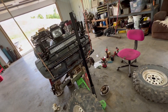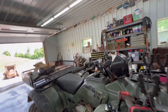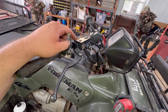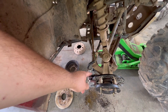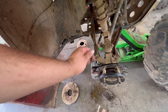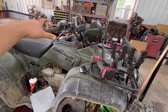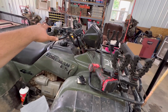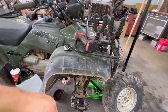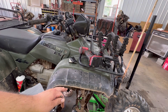We've got both sides all installed here. Now next, to bleed these brakes — the only thing I'm going to do for a start is make sure my master cylinder stays topped off, and I'm going to do one side at a time. I'm just going to crack the bleeder and let them gravity bleed until I get a good stream coming out of it, and I'll tighten them up. Once I get both those done like that, then I will probably have to have somebody help me, or I'll put a bungee cord around this and pump these up and hold the pressure on them and crack the bleeder to make sure it blows the air out of everything. And then we'll do a test ride on this.